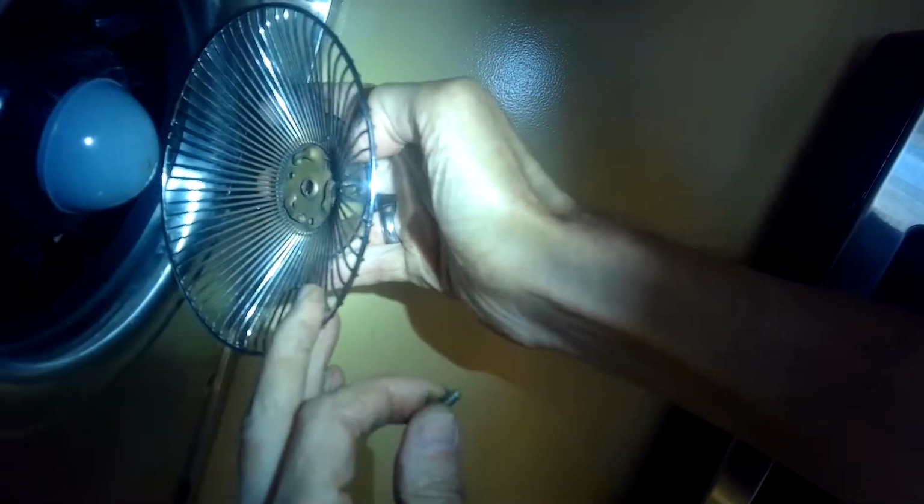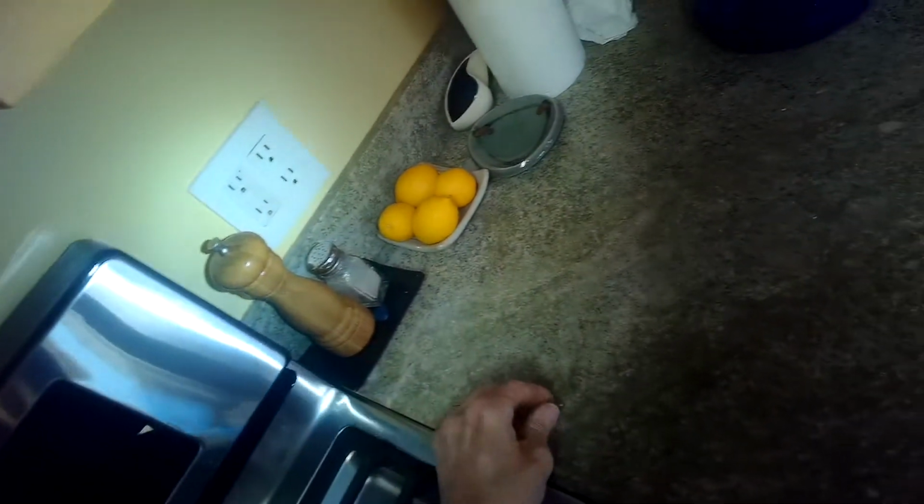There was a roof problem and some water came down and actually dripped out of this one on the right here. And then ever since it's been pretty noisy. So I think maybe the bearing got affected by the rainwater. Might have rusted it. So I just want to take a look, see if I can lubricate it. So I'll pull off that little cup.